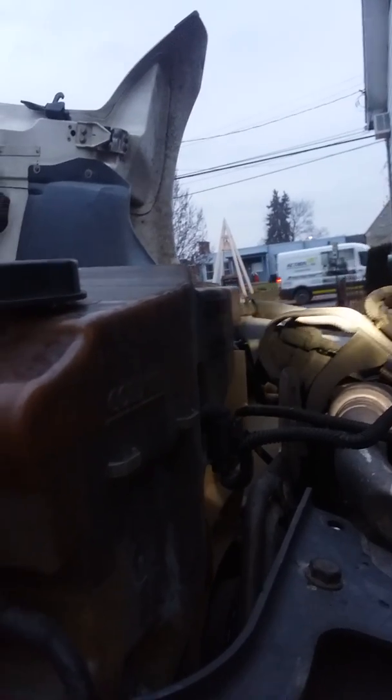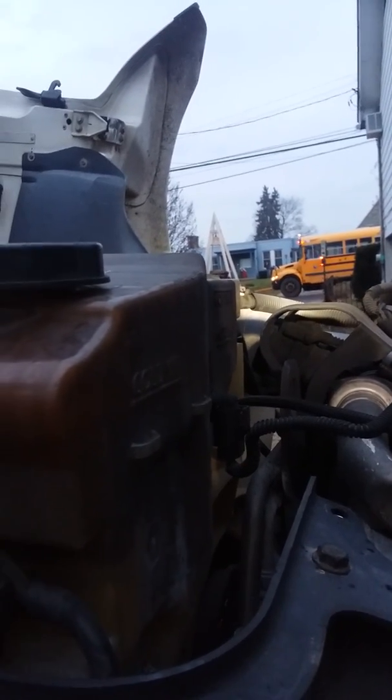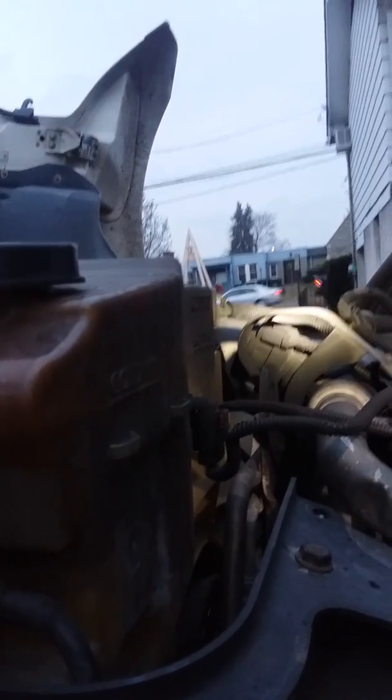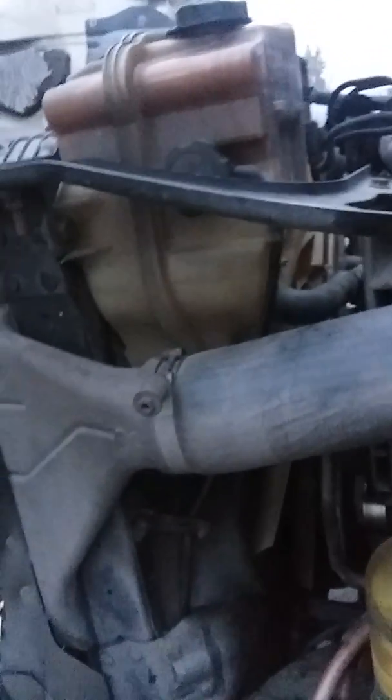I'm already seeing something that I don't like. You see that hose right there? I'm going to take the light off of it — you see where I put the light on and take it off? That's a lot of extra gap. I don't like how that looks. It's loose, it looks. That's going to start leaking and giving me problems. There's the hose right here — I shone the light on it. That's loose around that clamp. You see that? That's a lot of space. I'm going to give that a quick once-over. That could definitely lead to some problems that I don't want.